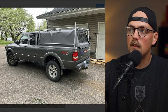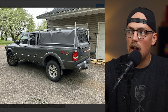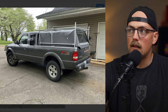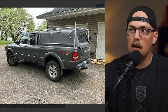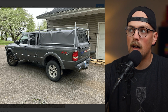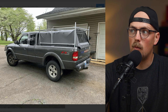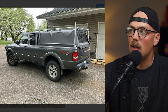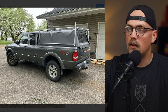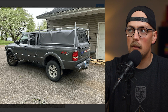This build was recently shared and it's awesome. This is a Ranger truck, and it looks like the builder has a soft top in the back — probably used for camping or protecting things in the bed. There's a framework inside that pulls the soft top tight, so you can't put weight on top or the frame will collapse. So the builder built this rack for their John boat, with four verticals — one in each corner of the bed — using one-inch EMT conduit and one-inch EMT connectors.